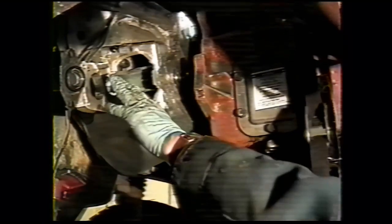That allows you to turn the output shaft of the transmission to line the transmission splines up. We've got it lined up into the splines there. We just got the clutch release to go onto the input retainer. That can be pretty tricky sometimes. Just take your time if it doesn't go.